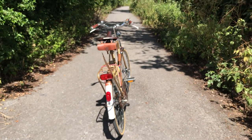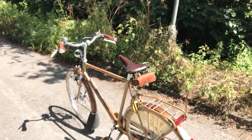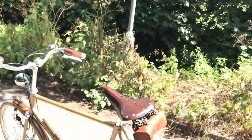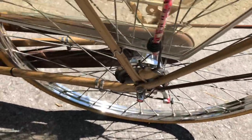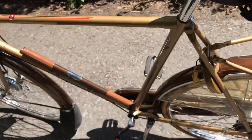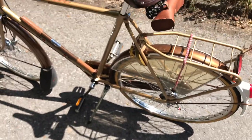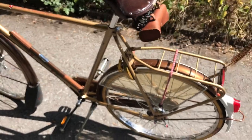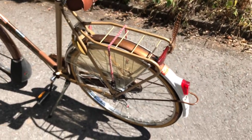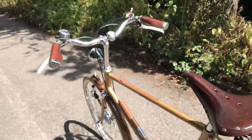It's very similar to a Raleigh Superb in many ways. There are ways in which the Superb is nicer and ways in which the Gazelle is nicer. The frame on the Superb is slightly nicer — this has got bolt-in rear stays and the ends are squished tubing rather than being brazed into lugs. The lugs themselves are quite utilitarian and straight, except for the head lugs. So the Superb's nicer in that way. This has got Gazelle's own threadless bottom bracket as well, square taper. However, there are ways in which the Gazelle is nicer, just because of the quality of the build and the engineering in it. Stainless everything, of course — the same as the Superb — otherwise very similar.